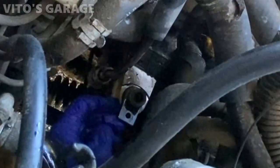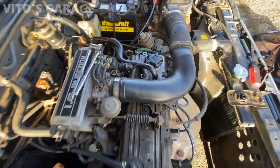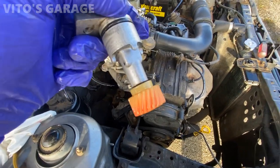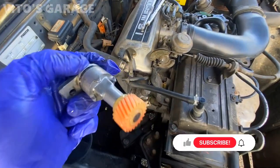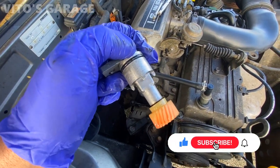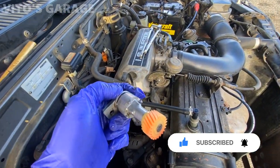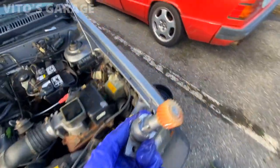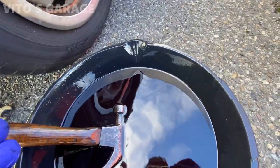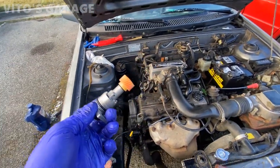Okay, there it is — all the way in, and now pull it. That's basically it, it's your dipstick. Right there she's full. I could probably add a little bit more but it's gonna be okay. According to the manual, I put like five quarts because before this thing was super low — the transmission probably only had like two and a half quarts and it's supposed to have like five or something. But yeah, now I'm gonna install everything back and we're done with this fluid change.